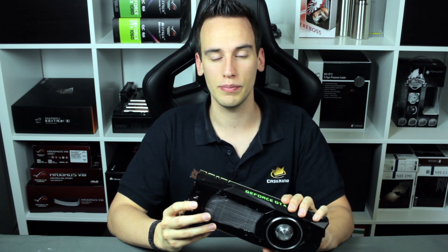We will do all kinds of modifications. First we will do normal air overclocking, then power modifications to unlock the power target, then a GPU volt mod to unlock voltage control so we can push the voltage a little bit and see the benefit of increased voltage. Then we will mount an EK water blocks full cover GPU block and see the influence of better cooling. I'll use a special chiller with water temperature around 16 degrees, making it very suitable for overclocking.